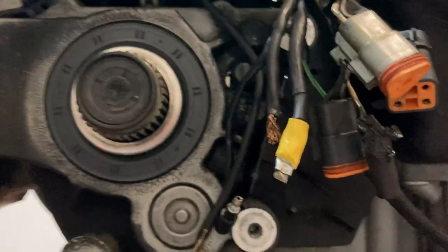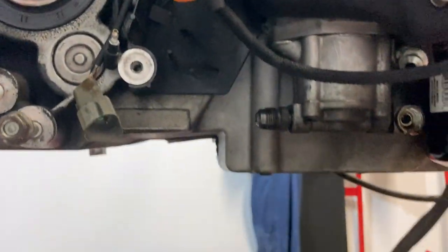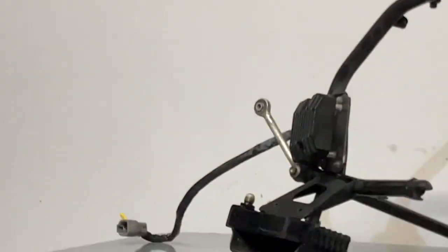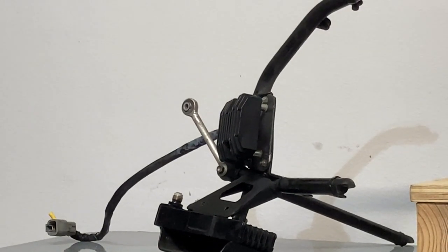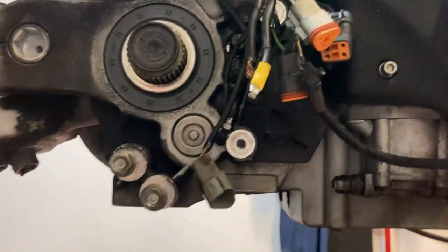Let me talk to you about this. In the time-lapse video you might see me clipping these two wires — that's coming off the voltage regulator, which is one of those Rick's Motorsport units right there. I highly recommend that voltage regulator. It does cost more money, but it is worth it. Big upgrade. That's MOSFET, so it never gets hot.